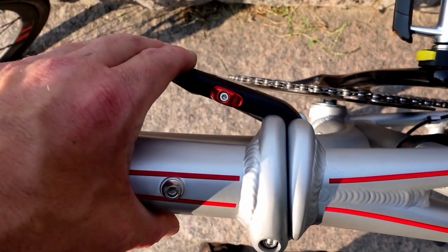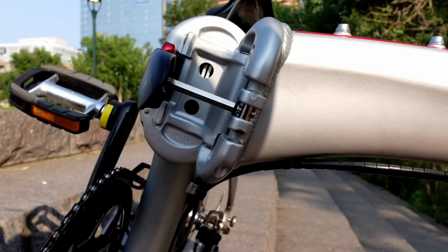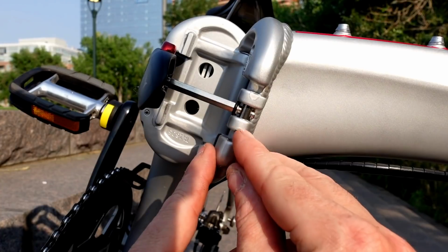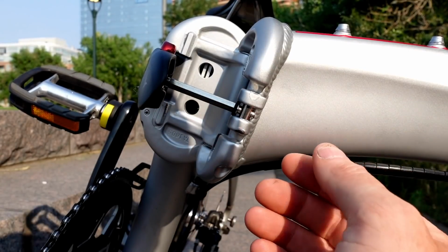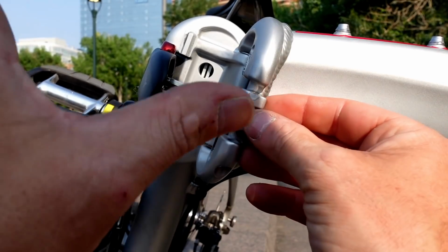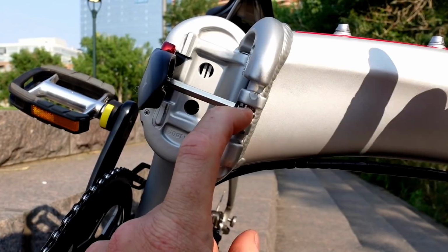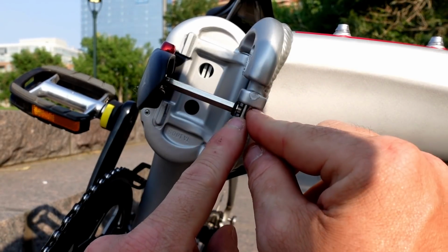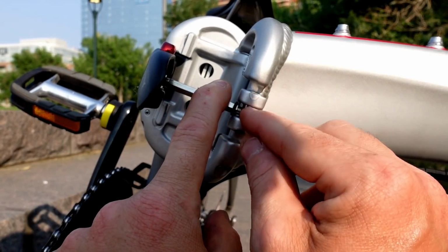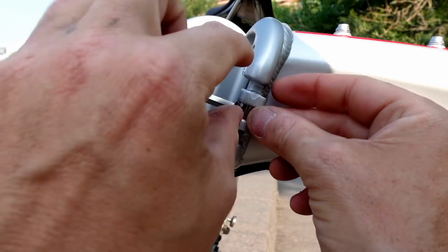It has a very strong clamping design, and anytime you close that latch, it really locks into place very hard. So this chip might have been from opening and closing the bicycle frame. But this is a very, very thin piece of aluminum, and already you can kind of see a little bit of damage. I've never wrecked this bike, but this damage could have come from just opening and closing it, which makes me very concerned. If this bike actually gets into a wreck, is this piece going to break? If this piece breaks, which is part of this side of the aluminum frame, that rod, that pin is going to come out. That pin can also break as well, and this rod can break. So that's 1, 2, 3 failure points, especially this little E-clip. That could come out and actually cause that whole pin to open up.